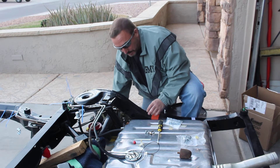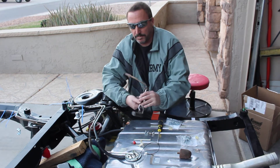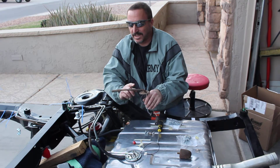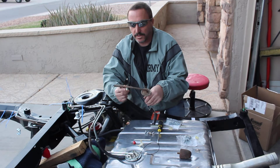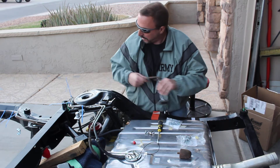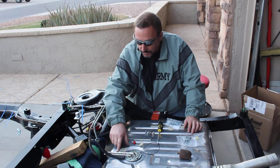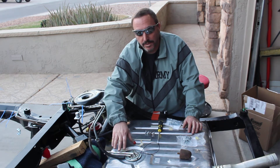The old fuel system that came out of this vehicle had one line built in — just one line — and this particular one-line setup is not what I'd consider great. This was the setup on a typical 68 Chevelle. So I decided to ditch this particular system and go to a two-line setup. The two-line setup, which you see here, is on later model Chevelles, but it doesn't matter whether you're building a Chevelle or anything. If you can get a two-line setup, that would be my recommendation.